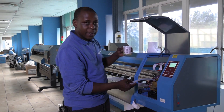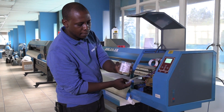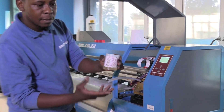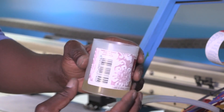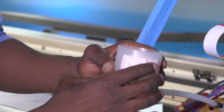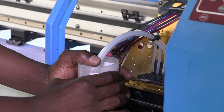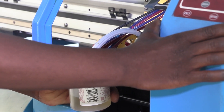Next step: your cup with your cleaning solution. You may need about 50mL to efficiently empty all the ink on each of the damper positions. There are six positions on an XP600 head. You're going to use the dampers — just dunk the pipes into the cup and let's go over to the maintenance options on the machine.